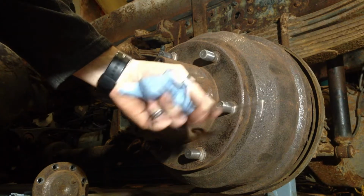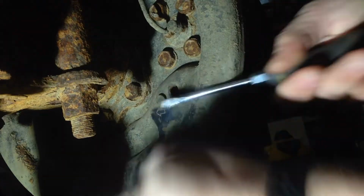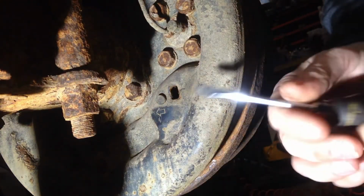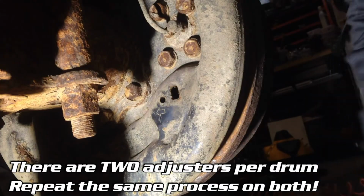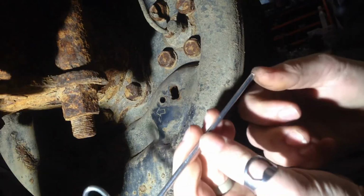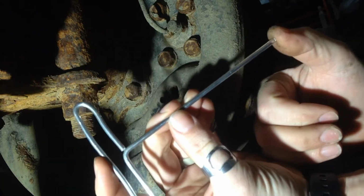There's a little cog. This releases the tooth from the cog, and then you spin the cog with a flat blade screwdriver. First thing you need to do, pop these rubber plugs out, don't lose them. You are going to want to put them back in after. So there's the square one and there's a round one. Pop those both out. And then our special service tool, which, by the way, is 159 millimeters long from here to here.